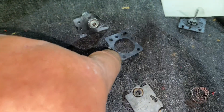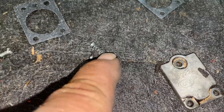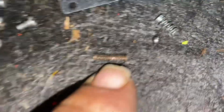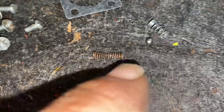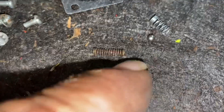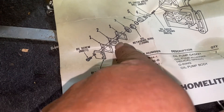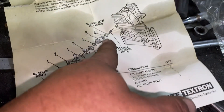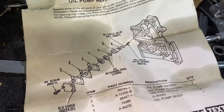I didn't have the spring so I started figuring out a way to make one. My first attempt — the ball was too big for the spring, it just slides up in. So I went with this spring here — a metering lever spring. I think it'll work as a check valve; it seems to be the right size and about the right spring tension. It also has this other spring that goes right here to help push the diaphragm out. The crankcase pressure pushes the diaphragm in, that actuates the piston — so one spring pushes out and crankcase pressure pushes it in to get it pumping.